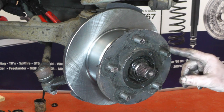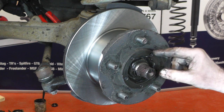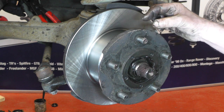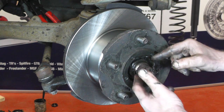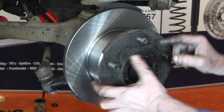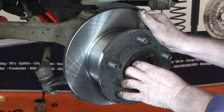It's worth mentioning that these are taper roller bearings on the wheel bearing on this Land Rover. Normally you do leave a little bit of play with taper roller bearings, but because this has got a sleeve in between the two bearings in the centre with some predetermined tension on it, that's why you tighten this nut up to 210Nm. Otherwise if they were normal ones you would leave a slight bit of play and then tighten the lock nut up.